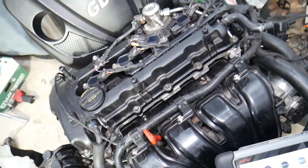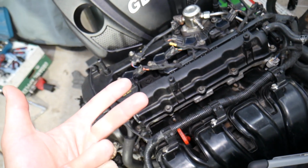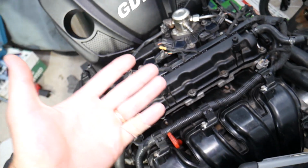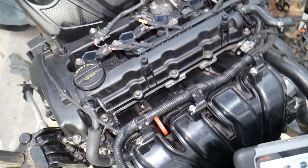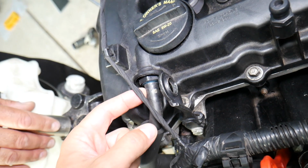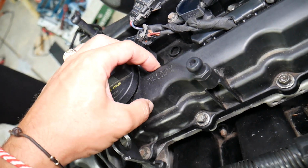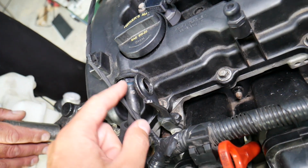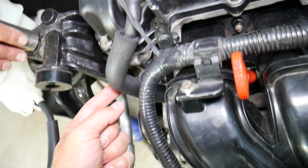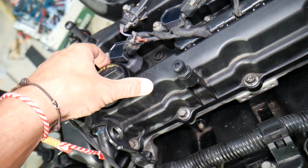But if that pressure doesn't come out of the engine, what will happen? You will fail gaskets, you'll start developing multiple oil leaks, crankshaft seals will start leaking, you may destroy your engine, and the head gasket may be affected as well. So they invented that valve known as a PCV valve, or positive crankcase ventilation valve. You have a device in the valve cover that separates the oil fumes from the air, and that valve itself does that too and injects the clean air into the intake manifold, where it burns through the engine, and the oil keeps dripping back into the engine.